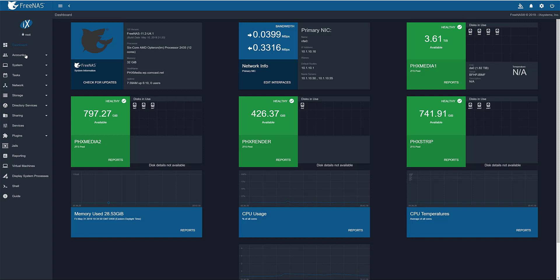Alternatively, what I'm thinking about doing — because I picked up a 240 gig SSD for about 29 bucks — I'm thinking of adding that second SSD as a cache drive for the FreeNAS server. What that does is basically act almost like RAM: you're able to cache things being written to the server on a faster drive and then write those things to the pools, giving you less of a chance of data corruption.